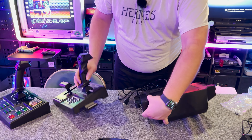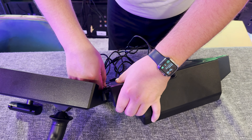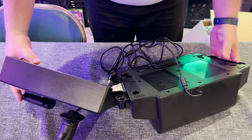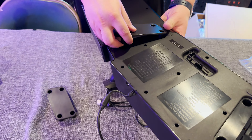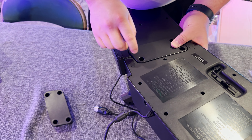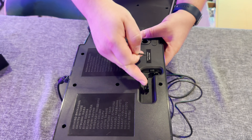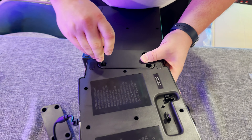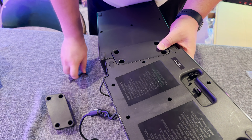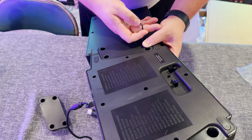Let me try to make this IDE connection here real quick. You feel like you're breaking it, and you don't want to pull too hard because these cables aren't exactly durable — but there is some wiggle room. Okay, we plugged our IDE cable in here, and this main control panel is going to key in up through here. Now hopefully you can see how the bracket works — the bracket goes over that, and then these screws go there. I'm only using two today. You're probably thinking, how do I get these screws in? Have a bunch of tools? They already thought of that — look right here on the main control panel. There is the exact Allen wrench with a place to store it, right there.